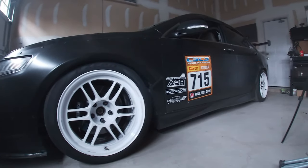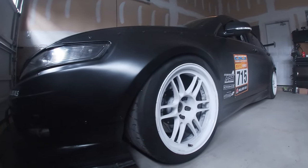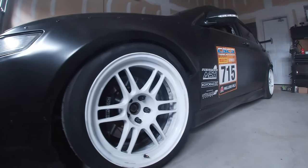So it's 3.9 on the right and 3.6 on the left. The rear is both negative 2.5 — we actually have no issue there and could go a lot more with the SPC camber kit, but we just don't need to right now. The car overall weighs 2,950 pounds, which is still quite heavy. Getting closer to 2,500–2,600 pounds would be better but that's a future project, possibly if I move up a class or switch out of OEM class.